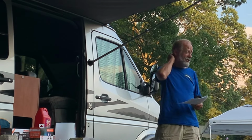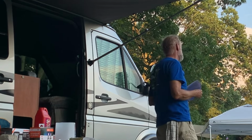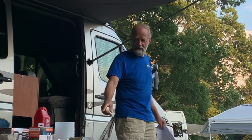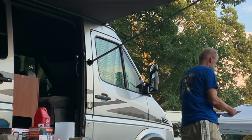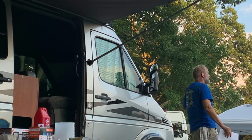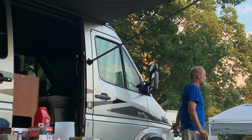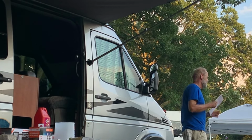In Europe, they are much more pragmatic. They have a similar rule, but they say, if you can bring me data, so Osram has gone hundreds and hundreds of vehicles and confirmed that the H7 LED works, and when you buy them, you get a piece of paper that says this headlamp is legal in this model of Sprinter or that model of Mercedes. They've not done it for this one because it's too old. They haven't seen that that's necessary. And you won't see a lot of T1Ns in Germany anymore because they all went to Poland and Russia. So they all have new ones.